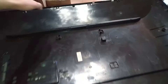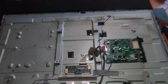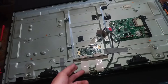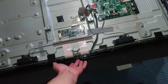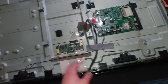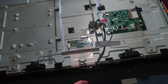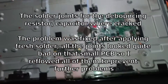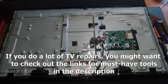That's pretty much it. The issue with this TV is that when you turn it off, it turns on by itself after a few seconds. I suspect it's something with the button, so I'll try disconnecting it to figure out if it turns on by itself. I probably can't do that because it has the infrared sensor right here, but I'll have a look - it's probably the button. Hope this video was helpful and have fun.